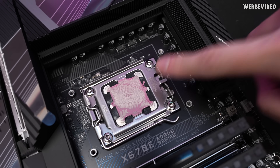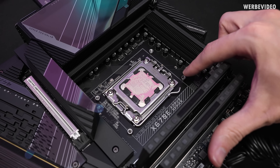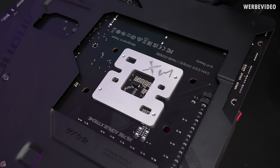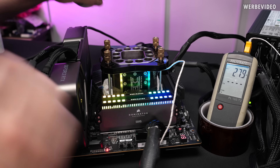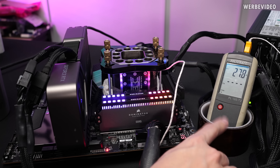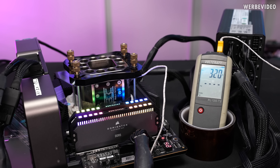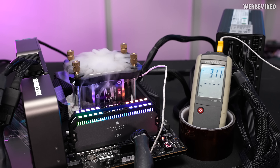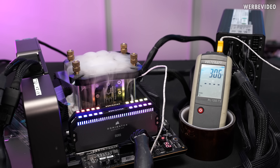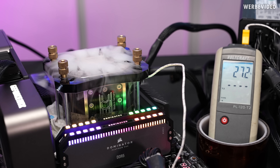After saving the CPU from a thermal paste incident, I swap to the different backplate shown in the previous video, since the UNC threads won't work with my dry ice container. With the backplate and dry ice container ready, my goal is to cool the container to a temperature that allows a peak core temp of 70 degrees Celsius — 20 degrees less than before. The heat from the CPU is so high that I need to add alcohol or acetone to the container to ensure good thermal contact.